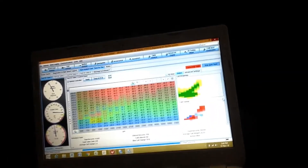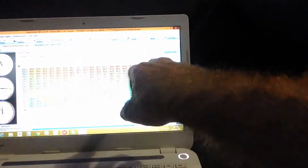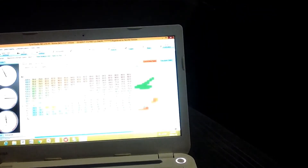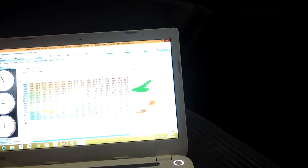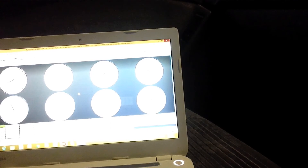There's the map, and this is the range where I've just driven it, and the adjustments that it's made. So yeah, my map's gradually getting filled in there. And you can see it now, just idling away in this zone — it's pretty stable. My air fuel ratio is on 14.6, it's pretty stable. The ignition advance is nice and steady. So it's looking very good. I'm going to apply that, save it, stop auto-tune, do it again, and get back to my gauge cluster. That's how we're looking at the moment — everything's fairly stable.